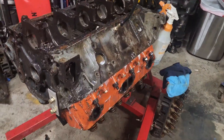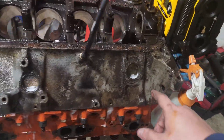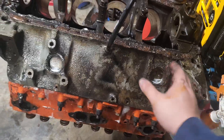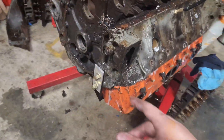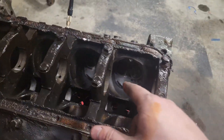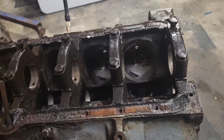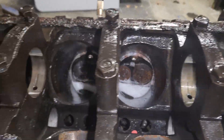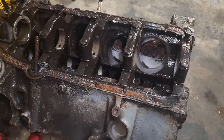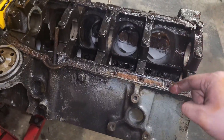Everything's good. Also — I didn't even think about it, but you've got to have your core plugs in, and this is also a good test to see if those are leaking. These ones are going to get changed out no matter what, but just a side note. So yeah, this all looks good. I tested that spot in that one cylinder I was looking at really well — nothing, no bubbles or anything. Pretty happy with the way that this turned out.